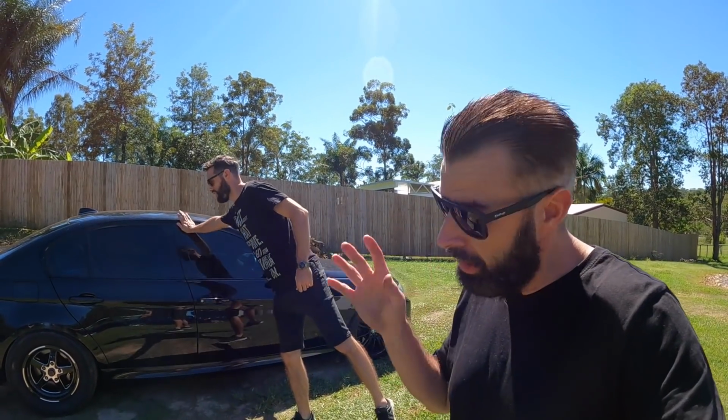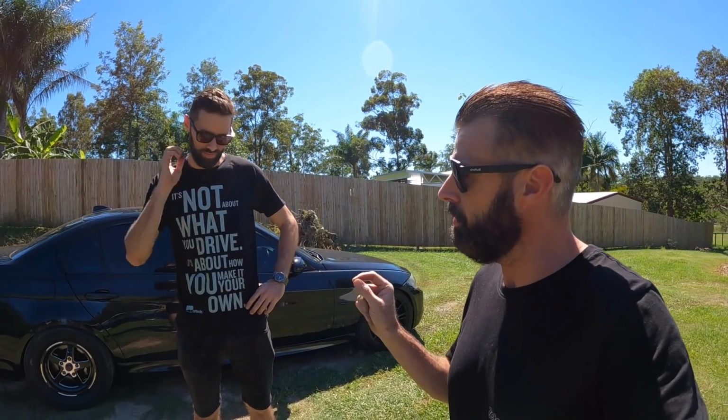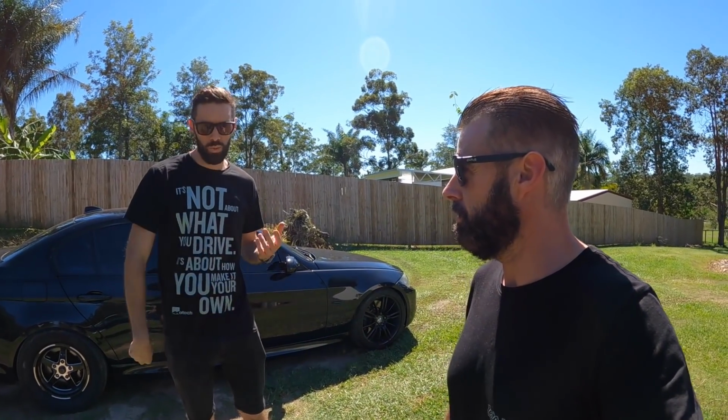Okay, so we've done another couple of coolant bleeds. We've done 2 heat cycles, like let it get hot, cool it down. Got some coolant in it. We were going to run it with water, but we've decided to run it with coolant. We're going to go and take it for a test drive. Now, the deal is, I want to do 6 pulls, no misfires, under heavy load. We'll go and do rolls. Alright. If it misfires once, we're not doing rolls. Fingers crossed.